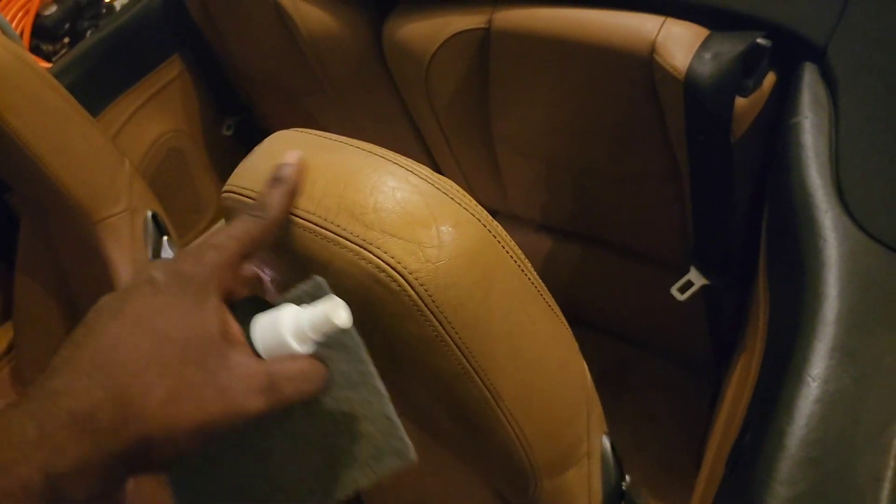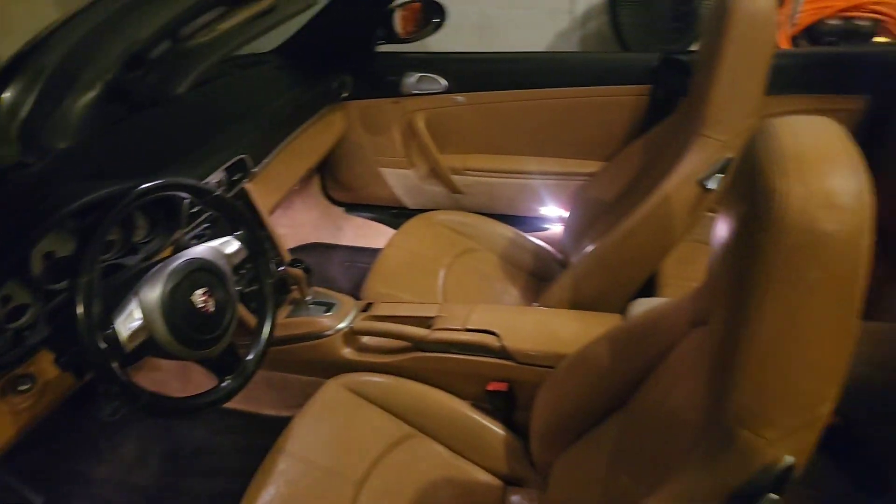So back to that one issue I had before — it was sweat, windows up but top down. They created a lot of heat and moisture that sat and caused this to get hardened. I tried to steam some of it out and steamed some of the color out, but there is still a little deforming. I'm almost tempted to wet sand this just a little bit. I see some little crack marks here — I don't think I have to use any filler on those, but I might pass just a little filler there to bring it back to really good quality. And I'm going to leave some of these stress marks the way they are, because it just shows proper aging of the car. I'm going to clean this up and touch up this bottom piece where keys and things like that hit. As long as the color matches up, this should do really well.